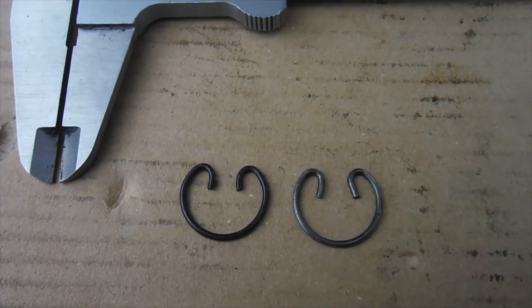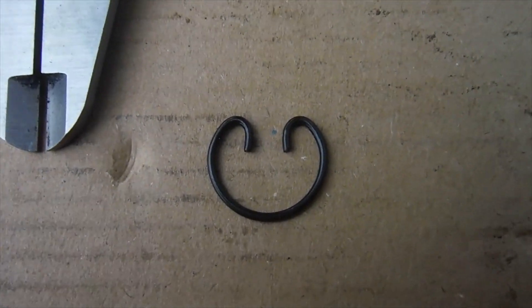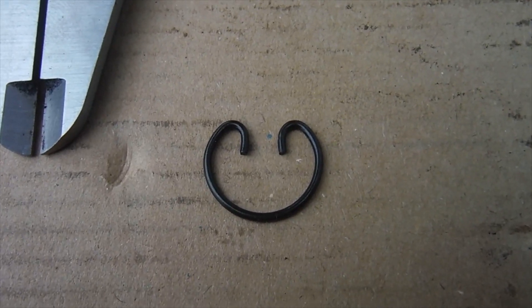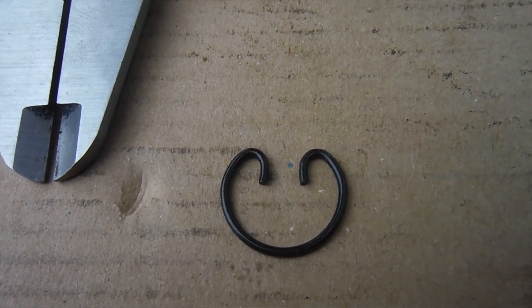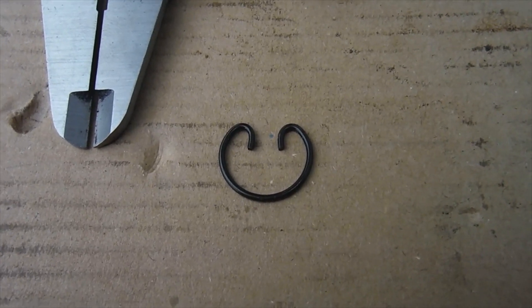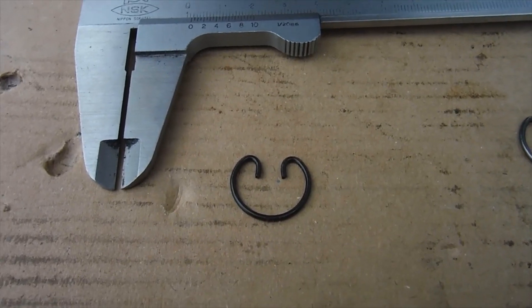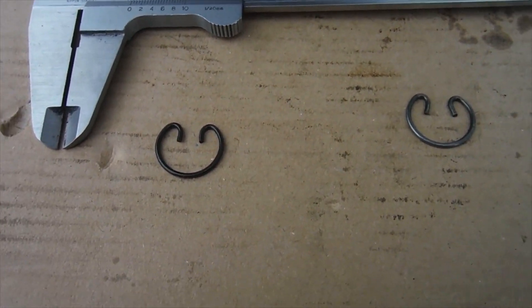That really is the only difference I can make out. The replacement piston will be going in using the circlips that came with it — it's low miles and I've got no qualms about reusing a circlip if it hasn't been distorted in any way. You actually have to be pretty rough with them to bend them out of shape when getting them out. I've used them over and over, even in race bikes. This whole episode is the first time I've had to deal with an escaped circlip in my entire career, which started in 1976.